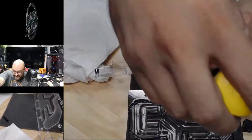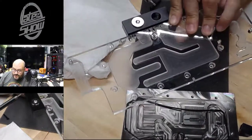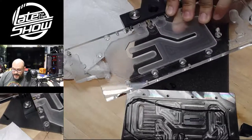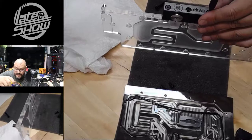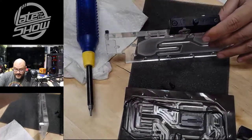Remember, look, you can see the screws, how you're passing them, penetrating. Try not to screw them too much in there because you could break the plastic. You could crack the plastic and it could be water could leak through there. It could be compromised through there. So you got to make sure that you don't tighten it too much because you don't want to damage it.